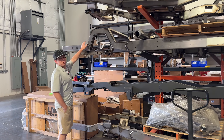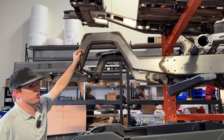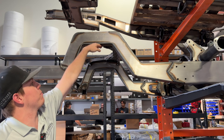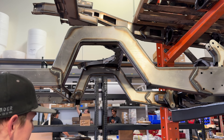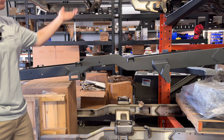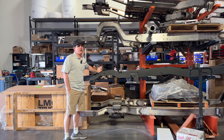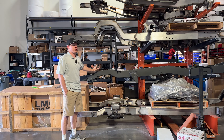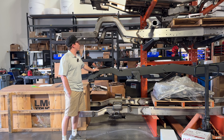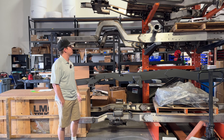Just another good example of the ride height levels. Not all C-notches are created equal. This one's going to have quite a big jump to it, and then this one is going to have significantly less. When it comes to comparing ride heights, it's actually a pretty good example with them right next to each other — you've got your low and your not so low. This is going to be your level one, just around stock ride height, maybe an inch or two lower. And this is definitely going to put you on the ground or at minimum give you a good drop to your truck.